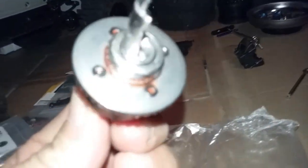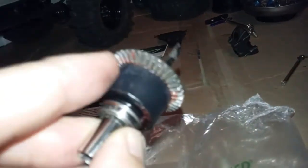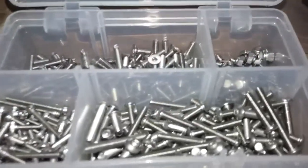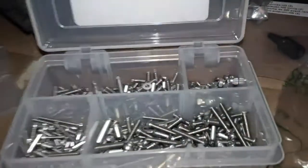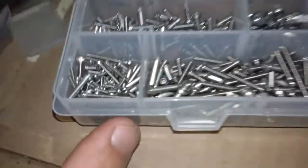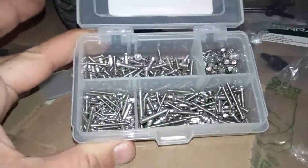Off camera I went and cleaned up some of the grease. Next I need to remove these four Allen screws to separate this ring gear from the differential cup. I also bought a Vaterra Twin Hammers bearing kit, so I'm going to be replacing all the front end bearings at the same time. I just opened up the screw kit — looks like they gave me three brand new Allen wrenches, which is pretty sweet. I can see the differential screws in here, a whole stack of lock nuts. I'll be happy to replace all the stock screws with these nice stainless steel screws — at least I won't have to worry about the head stripping out so easy.